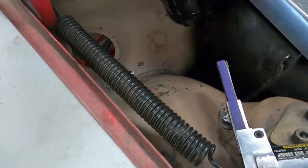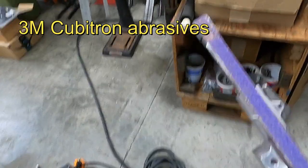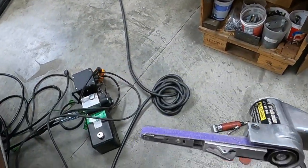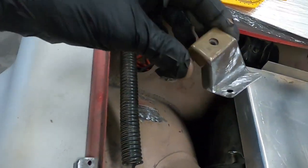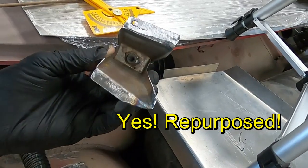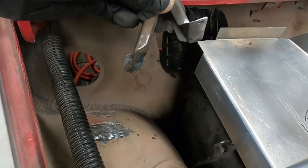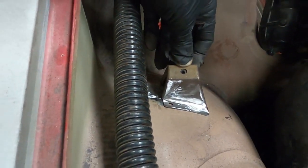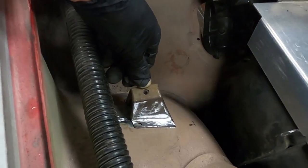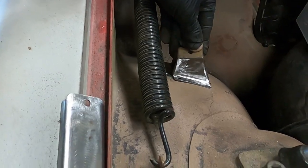Another Harbor Freight shout-out — these are great little belt sanders. 3M Cubitron abrasives are the way to go for this kind of stuff. The tool is nice, but the abrasives make all the difference. After that, all those welds cleaned up and I went after reshaping the piece. I added a flange onto it, which I'll drill for some rosette welds, and just re-tipped it to make it fit. It's going to sit right there, almost looks factory — and the fuel filter will mount to it. Pretty happy with how that's turning out.